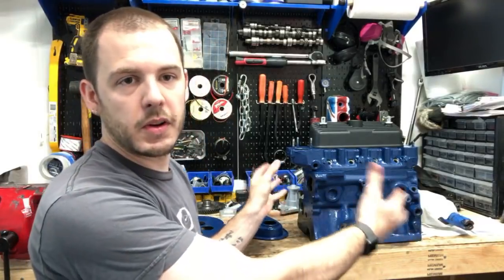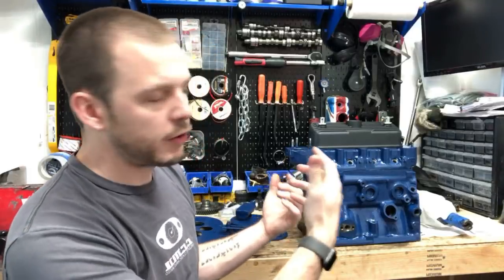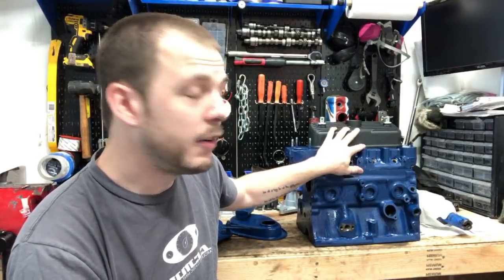Jack says, would you fit a turbo on your Mini? I probably would. I probably wouldn't do it on this Mini. One of the things about turbo motors and supercharged motors is you want to start from an empty block. You want to start from a base and build it up to be suited for the turbo. Specifically the pistons, because not all pistons can really handle that much boost. And then connecting rods, then move on to the crank. I mean, really everything. You just want to spec it to the turbo. Realistically, I probably could get away without doing that, but if I was going to do it, it would be a new motor, a second motor, and then I don't even know if I'd put it in this Bad Wolf Mini. I'd probably put it in another one.